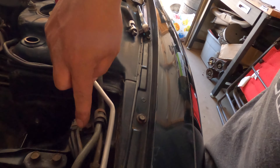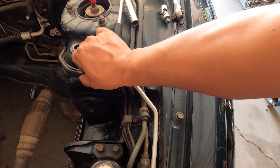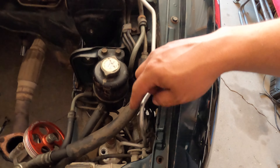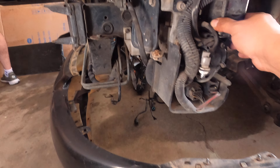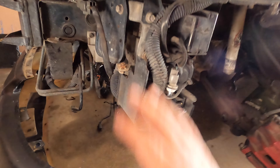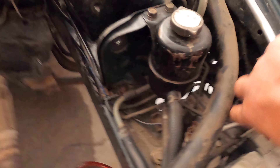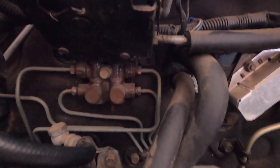One thing I did forget to mention is we're also going to be removing the ABS, and that involves removing all these lines around here. This is one good way to know if you have ABS equipped on your car — most likely you're going to have these hard lines running through the strut tower here. We're going to be removing the ABS unit, and you obviously need to remove the front bumper in order to even access it. There's a series of 12 millimeter bolts holding onto it, and before I loosen those I'm going to loosen up the lines here with the line wrench. Then we're going to remove the proportioning valve which lives right here and install a non-ABS proportioning valve.